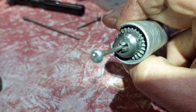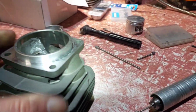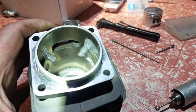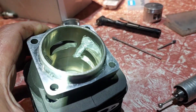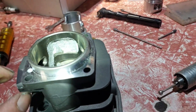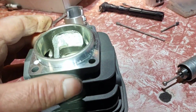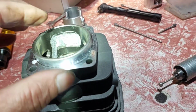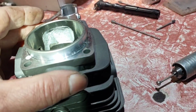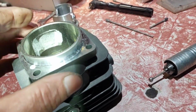So that will go in the groove. I've grooved it out, a nice little dish all the way down to the boost port, so that should work well. I'm at the line where I want to be with the upper transfers, so I'll give more air. Now the lower transfers, because the base is quite light because of the piston design, I'm doing this dome piston. I don't know how far I can go without busting through that lip just here, so I'm being very careful of that. Once I work that out, the next step is to work out my squish and all that.